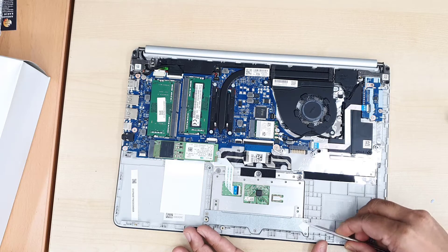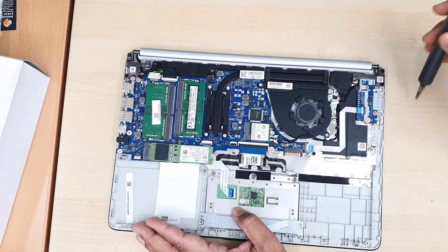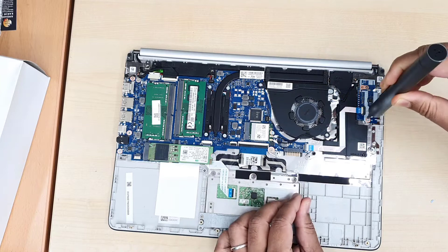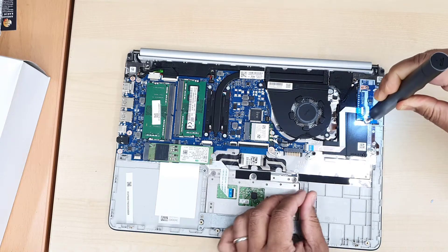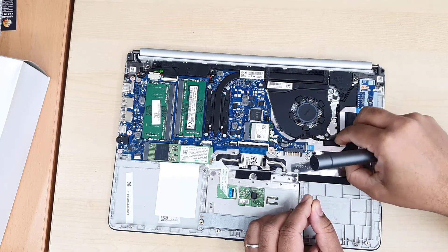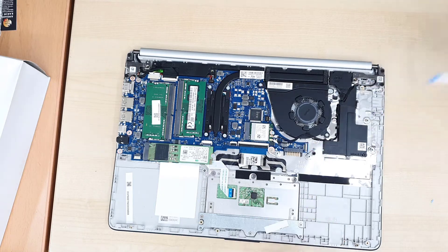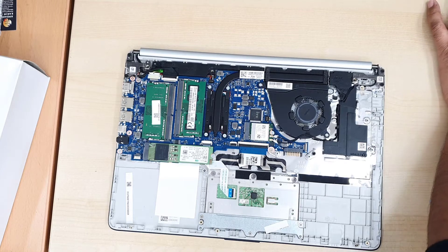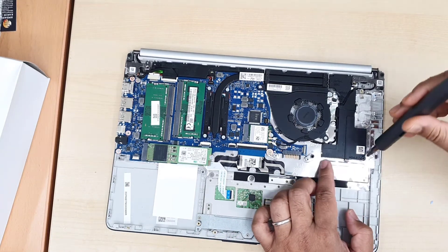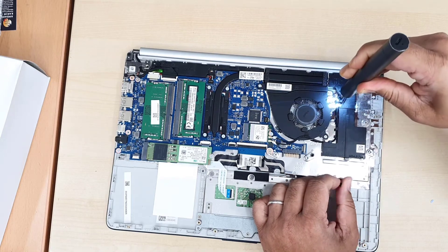Make sure you check every single sticker — sometimes underneath the sticker there are a lot of screws hidden. Open all the screws that you can see and make sure you keep the screws organized. Otherwise, short and long screws would mix up and that could lead to a big problem. Also be careful when you disconnect any sort of flex cable, like the power cable, the LCD cable, the keyboard flex cable, and especially when you take out the SSD. Then we're going to separate this panel from the LCD panel, put everything back, and it should be fine.